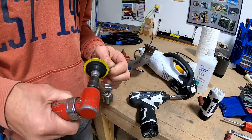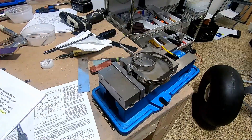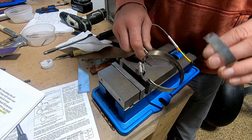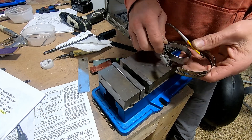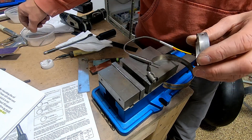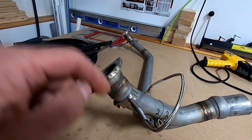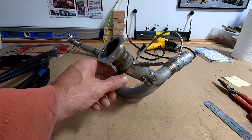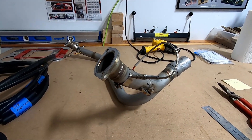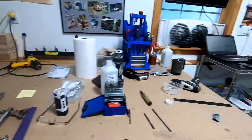The 29 hole fits very tight. If I drill that and ream out to a 30, I can't get it in. I think I'll do the 29 — that seems to be a safe bet. The 29 hole gives you a good tight fit. I torqued it down to 35 with the 30 and that didn't go in even after reaming it a little bit. If anybody cares, I cut off four and three quarter inches off of this strap, and you leave about two inches of the threaded part, which equates to about 20 of those little thread grooves. All right, time to do the other side.